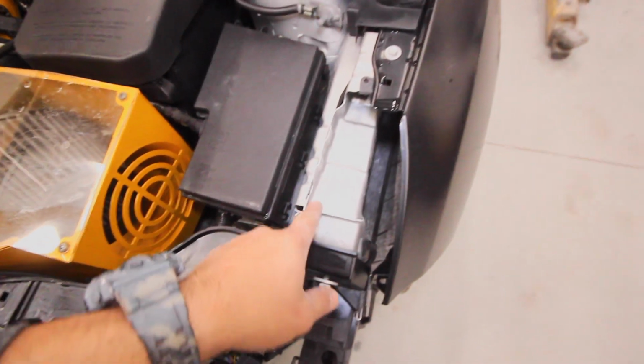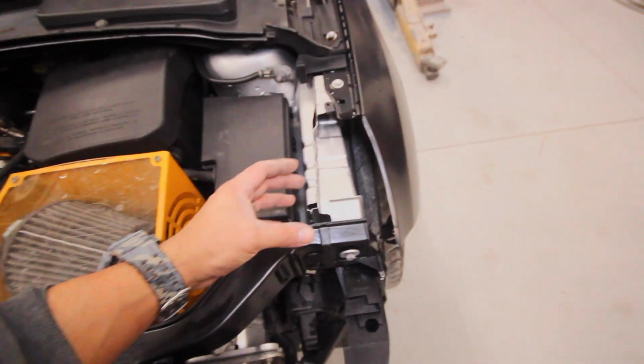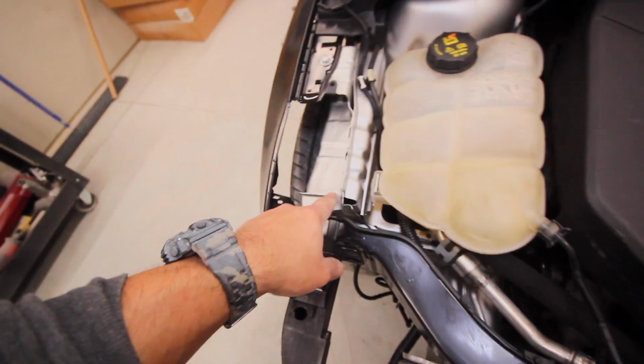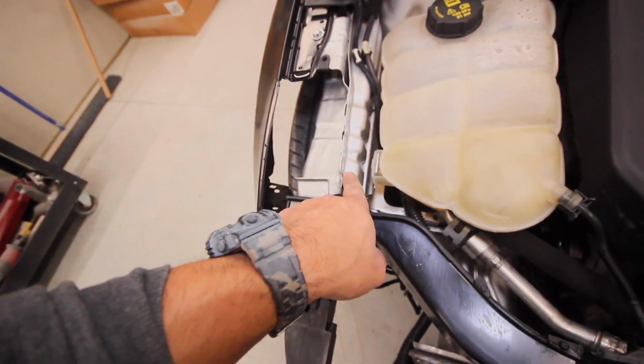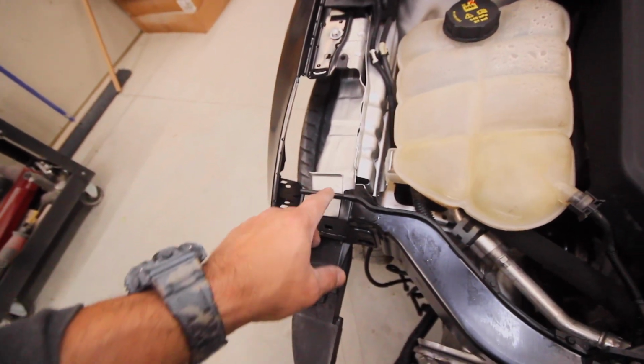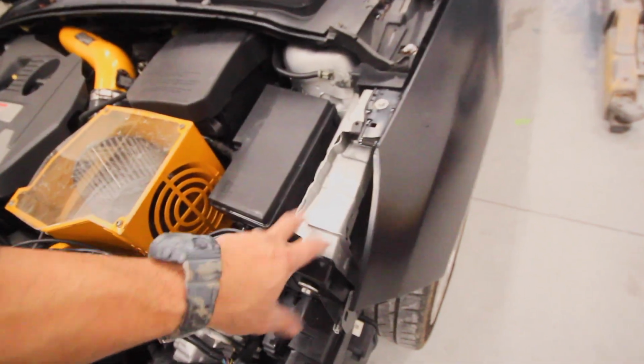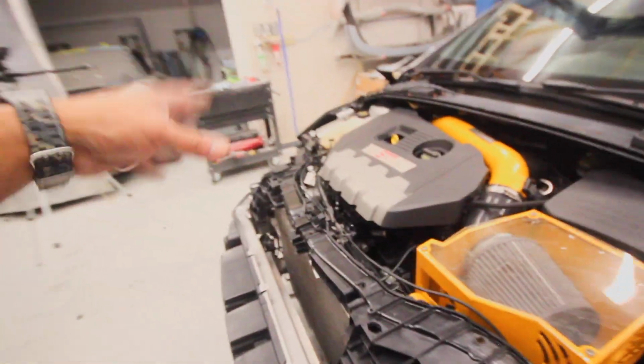Looking at this top here, that buckle looks kind of normal. It looks like they usually purposely kink it in your crumple zones. They do. That's why this whole thing is ribbed like this. It looks like a spring. This one's a little taller, and the paint is actually broken around it, which means it's a little higher than it should be. So, all right. Let's take this whole thing off and see if we can tweak these back to where we want them to be, and then if we put that piece on and it lines up, maybe we can throw some headlights on there, or even the hood.